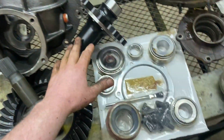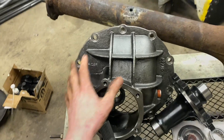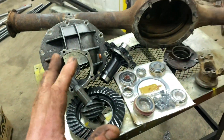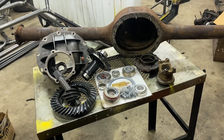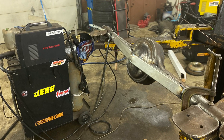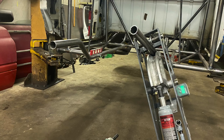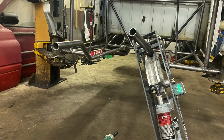We have 2.73 gears, a full spool for the 9-inch, a full rebuild kit, and a new third member housing compared to the stock one. If you want to pick up any of these parts they'll always be linked in the description below. Then we had a blast welding in that back bracing with an awesome YesWelder, which melted it in real good. We got her all lined up and built our custom four-link for it.